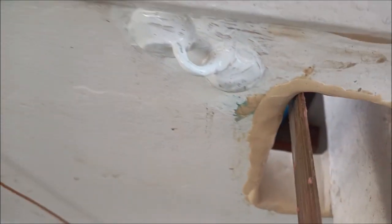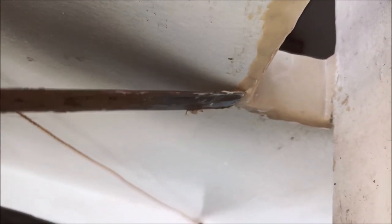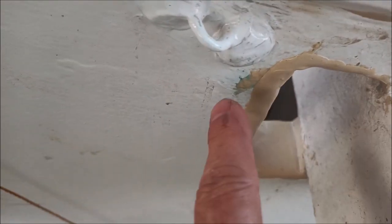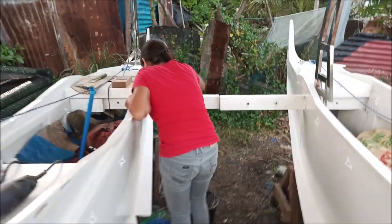I'm smoothing it up and trying to make it flat. The top one has to be a square angle too, so I push it in and up to make it square. This epoxy will sag — see that bulge coming out? That's actually going to be a stronger point. We're running the epoxy over the edge too, just to get a good seal. Where I cut, if you just run it to the edge there might be little openings and water gets in slowly over time and you've got a problem. My wife is doing good — she's using her fingers and I'm using the sharp edge of the bamboo.